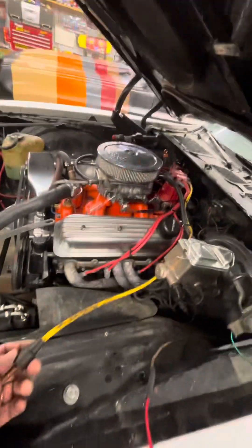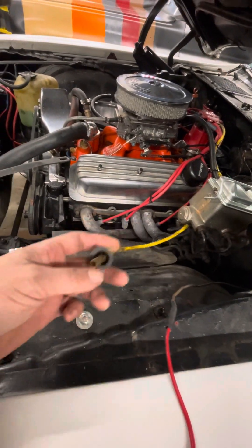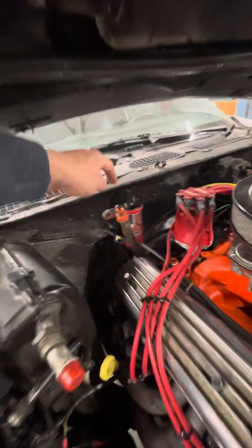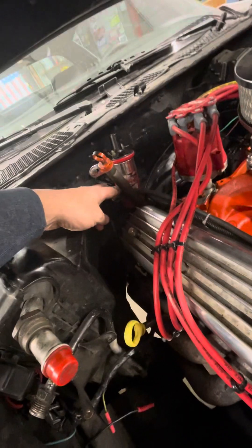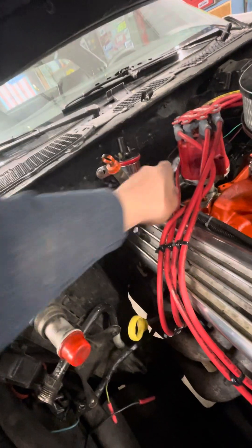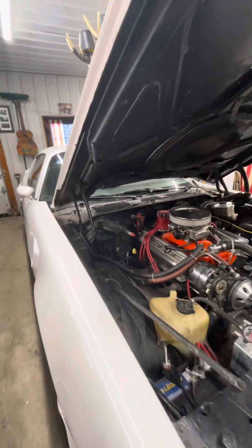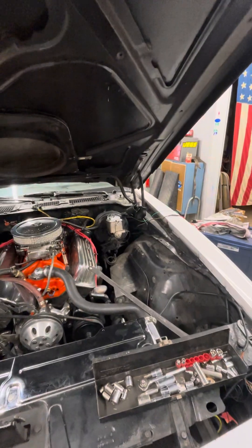This is the wire that feeds the coil on the point on the distributor, in the center of the distributor. I had it mounted over here before with just a spark plug wire, and I put one of these ends on it for the wacky style coil pack — like one of these old style ones. I ran it into the body ground just for now to see how it would look. I want it to be lower, because when I put the wire in it's going to be up high. I'm trying to see where I could get it back here where it'll look decent and won't be all bound up with the dipstick for the transmission. It's going to be hard to get the drill back in there without taking the distributor out. The purpose is just to neaten up the motor compartment and get this crazy long coil wire out of here — more area for it to maybe arc or lose spark.